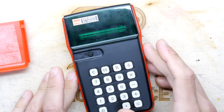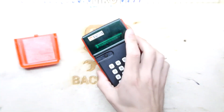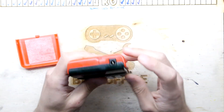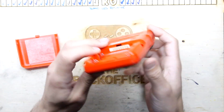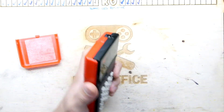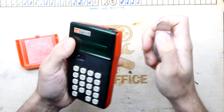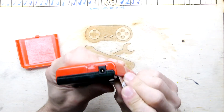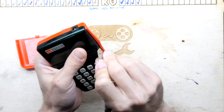The batteries do nothing, and I'm assuming those batteries are good — they are a mixed bag; I'm down to my battery dregs at the moment. That's okay because I can see there's a significant distortion in the color of the plastic, which can mean only one thing — something inside this has gone. I'm going to try to gently prise this apart; I didn't notice any screws when I had a quick look earlier.